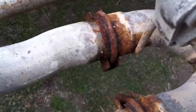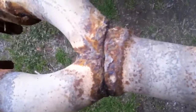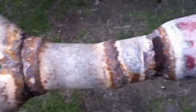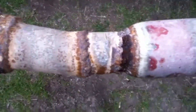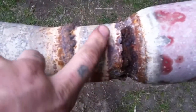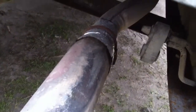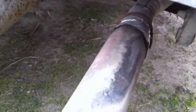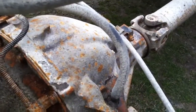I think I've told a few guys about the exhaust on this thing too. Look at this — not even welded. Look at the cockeyedness of this. Right here, you can see that's open right in front of the muffler. You can see where I've had to tape it because there was another opening in the welds, and further up at the cat there's another one, and on the other side of the cat there's another one. The exhaust is also really close down here — she's been rubbing the vent tube a little bit when the suspension flexes.